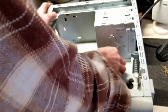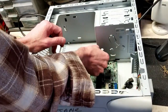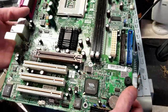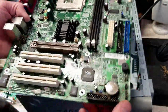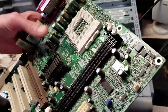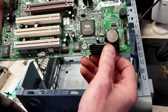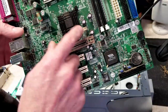The board appears to be stuck right where the screw was — there we go. Using a zip tie hooked behind the board, slid it over and pulled up, and it came right out. Here's a Socket 462, otherwise known as Socket A. The capacitors all look good from a quick view. A lot of times on these older boards they're either leaking or bulged. Primary and secondary IDE ports, 20-pin power connector, floppy cable port, AGP, 3 PCI slots, and even a connector for a chipset fan.